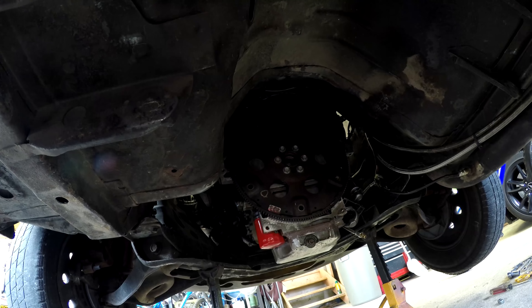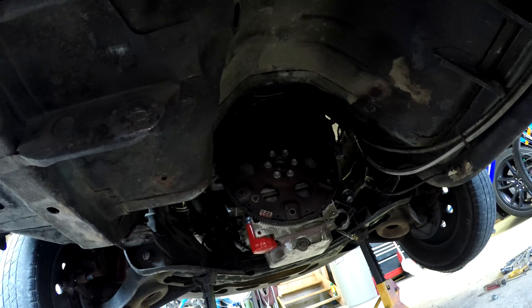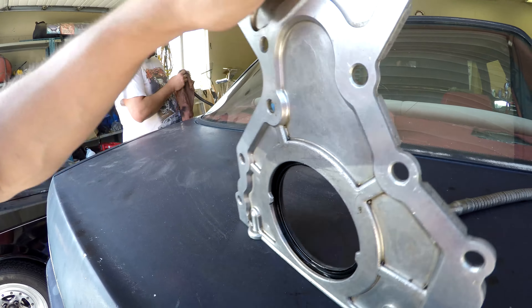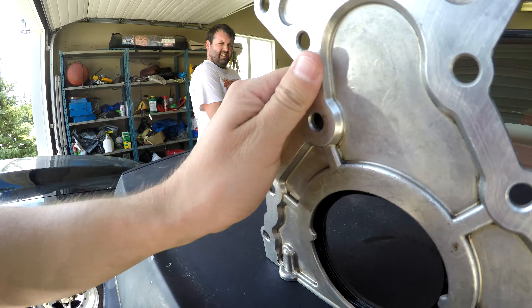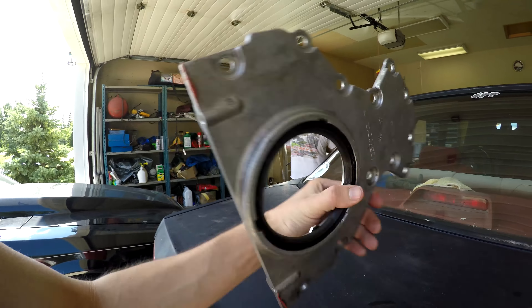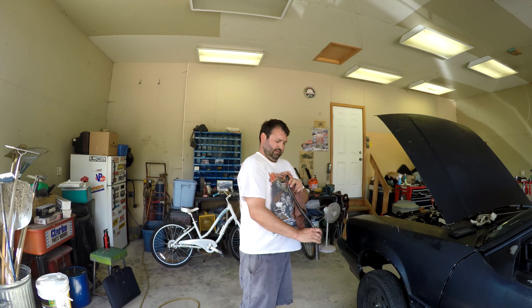Took the flex plate off, started it up, saw the leak was really bad. Took the rear cover off and we were wondering how this was happening because it looked like it was leaking out of the bolts that hold the rear cover on underneath there. We were scratching our heads, but on closer inspection we found we put the rear main seal in backwards. For an LS it is supposed to be the opposite. For almost any other small block Chevy conventional engine you want it the other way because the oil goes in and the pressure kind of seals it against the crank, but you don't do that with an LS. Clayton just finished putting the other rear cover on with the seal the right way, and it didn't leak.